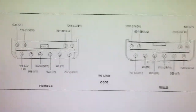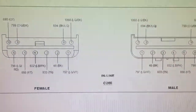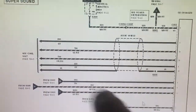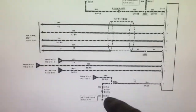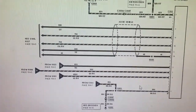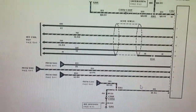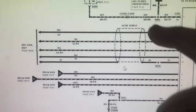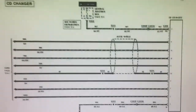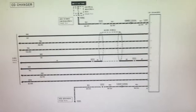Here's the pin-out from the connector on the truck — we took it off and it had the blank one, so we need to duplicate that. This is the Navigator connector: here's most of the CD stuff, then some other wires — positive and negative. You can see the negative has a splice, and so does the positive, and there were some other splices. Of course this was a heavier gauge wire that then split into two smaller gauge wires. The colors are basically the same except the power wire is a different color.